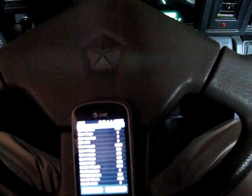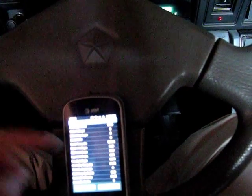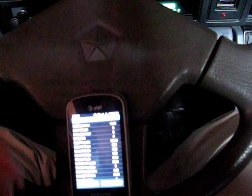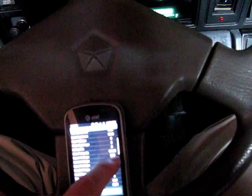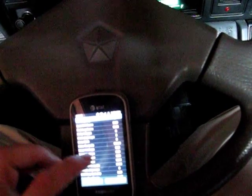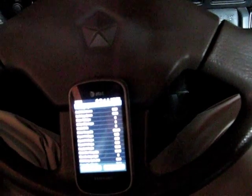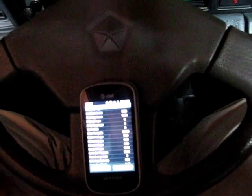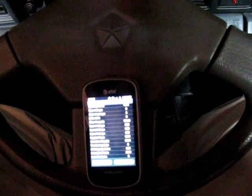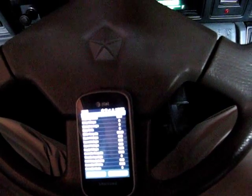That 159.99 reading may just be my program or possibly the sensor not being able to calculate higher than that. I'm guessing it's the sensor — 5.28 volts is where it topped out. Based on how I've got it calibrated, that's where we're getting, so we're showing 160 degrees Fahrenheit. The controller temp was 97 degrees when I pulled into the garage, and it dropped down to 94. I can hear that the fans have shut off now on the Soliton.